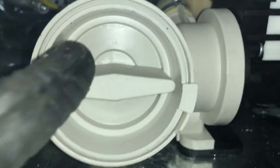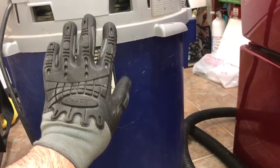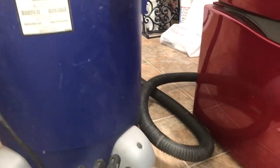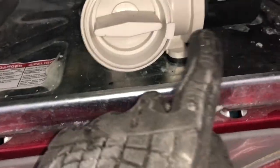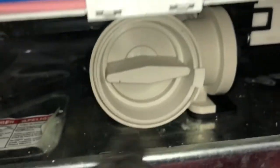I sucked all the water out of the drum using the shop vac because the F21 was showing the drum was unable to drain — so the drain pump itself was the problem. My impeller was shot. You reach your fingers into the hole: if you can play with the propeller and it spins, most likely you're okay. But if it's hard to spin, that's the magnets — mine was completely full of water, sand, and soot.